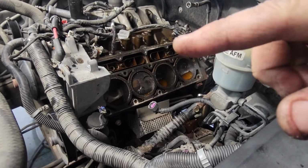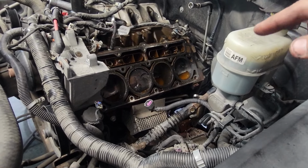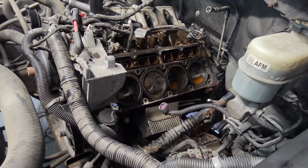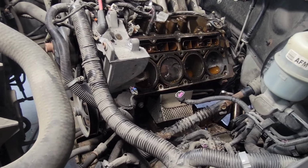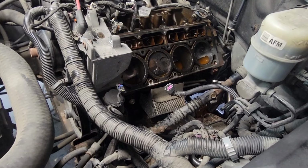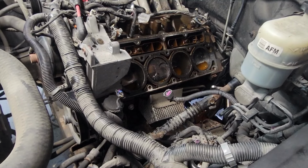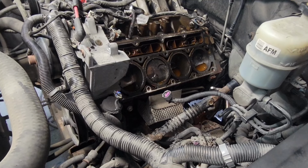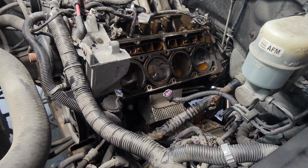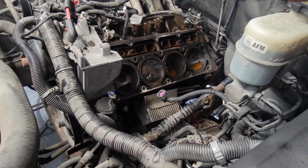All right. Even if you took your water pump off first, you're still going to have a little bit of coolant sitting in the heads that are on the vehicle. On the driver's side, you do have to take the exhaust manifold or header completely off. On the passenger side, it folds out of the way enough to get your extension in there without doing any damage. So one side does have to come off, the other side does not. With that being said, I do recommend taking off your water pump before you take off the heads.